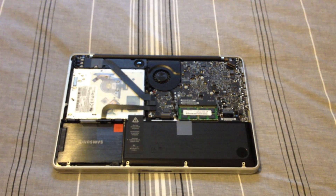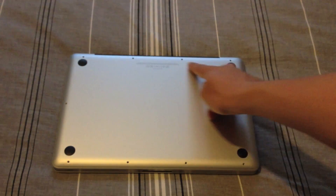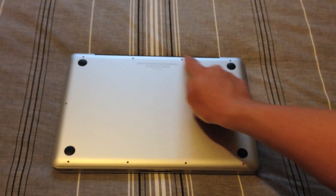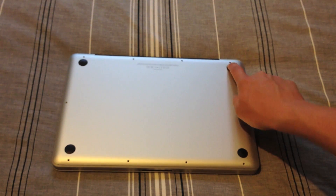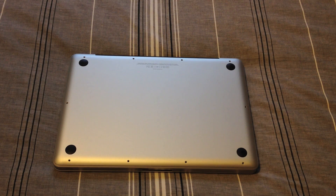Okay guys, that's it — we're now done with the SSD installation. All we need to do now is put the cover back on, do all the ten screws, and tighten them up. Then run the online recovery system. Just a reminder that these three screws are significantly longer than the others, so don't forget. Like and subscribe, thanks for watching, and don't forget to visit ideveloperstream.com. Bye for now.